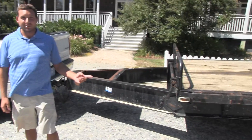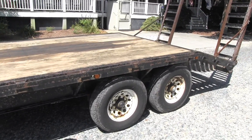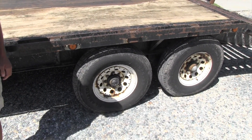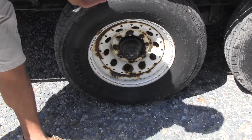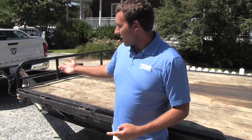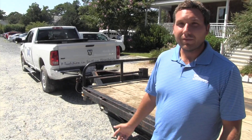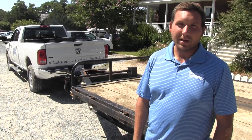The first thing you want to do is make sure the air pressure is low in the truck as well as the trailer tires. The trailer tires being aired down is the most overlooked thing we see happen. These tires typically hold about 80 pounds — I've got them around 15 to 18 right now. You just want them squished out like that; that's the most important thing, because if you don't air down those trailer tires it's just like pulling an anchor. The truck tires I also have at lower pressure — just below 15 pounds in the back and about 18 to 20 pounds in the front, which is a little lower than I normally run.